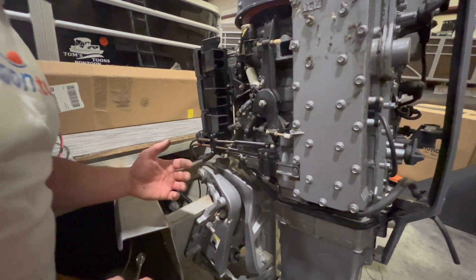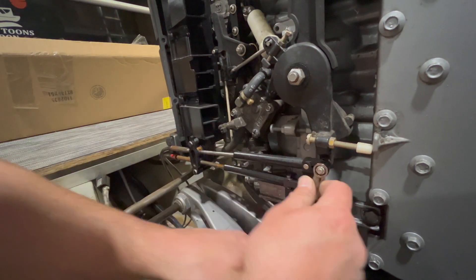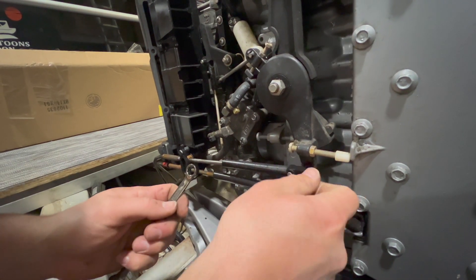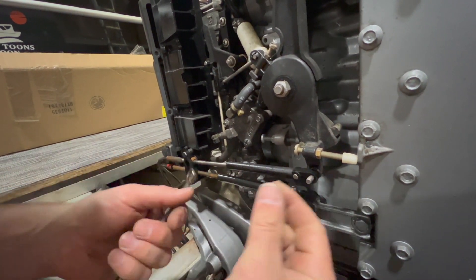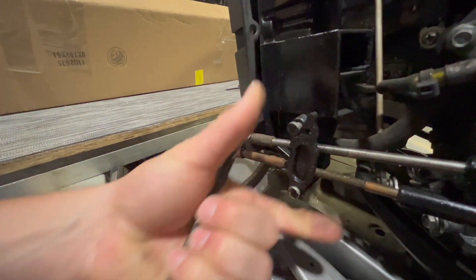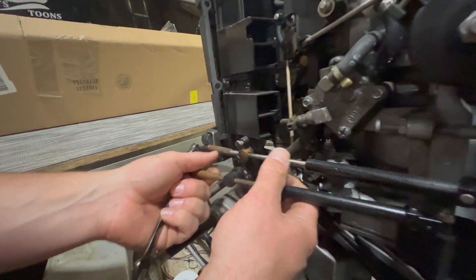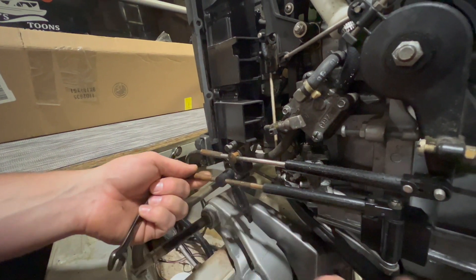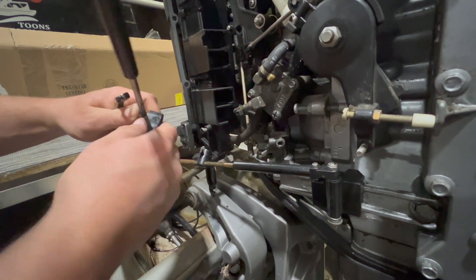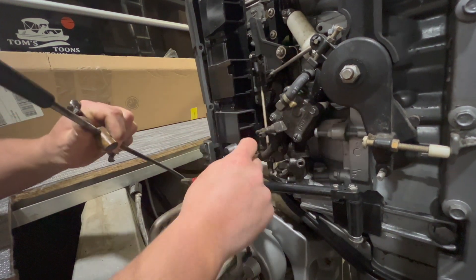These other cables coming in are my battery cables and my trim — they come around to this side. Mercury and Mariner made this really easy to do. We have a throttle cable hooked to our throttle body. I'm just going to undo it — this happens to be a 10 millimeter, usually it's either three-eighths or 10 mil. Take that nut off, and then with this clip here, I can pop that right off. That's holding my shift throttle cables in place. I can just pull my throttle cable out — if the black coupler comes with it, not the end of the world.